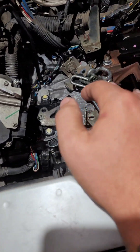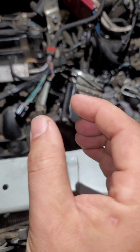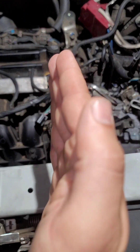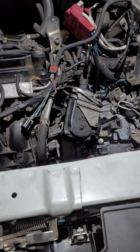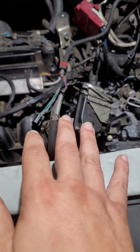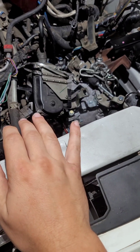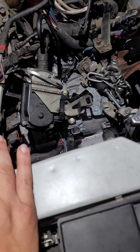It took about 30 minutes to get it lined up right — you want just a little bit of a gap. In a perfect world you want them flush up against each other. Ideally if you pull the engine and transmission out together that's ideal. I probably should have bought an engine and transmission combo with 57,000 miles, but I've got the knowledge now of how to replace the transmission, and the engine wouldn't be hardly anything.